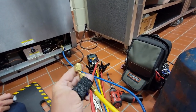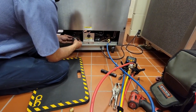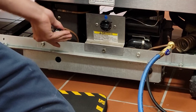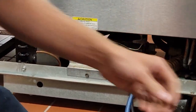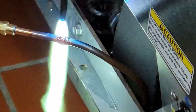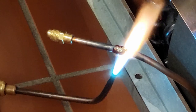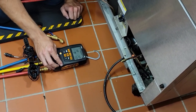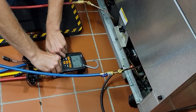We went ahead and relieved the pressure off this thing but it sure didn't seem like much - granted it only holds 10 ounces. Let's cut the high side, make sure you've got your safety glasses on - don't get frostbite. Let's go ahead and put one on it anyway. There we go - we've got one on the high side, one on the low side. Let's get that hooked up and see what we get. Yep - that kills that hypothesis. So now we know it's bleeding through from one side to the other.